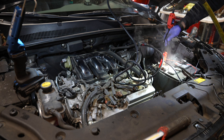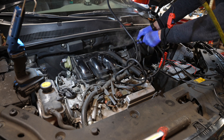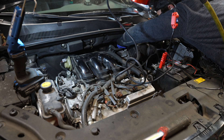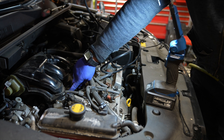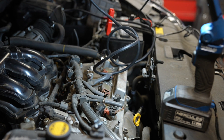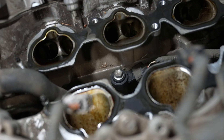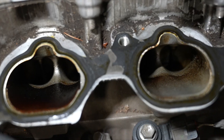The bladder system actually has an entry port so you can hook your smoke machine up right into there. The most important step is do not let this smoke come outside of the car because it's absolutely stinky and it only gets worse as the smoke dissipates. The general leak is either lower intake manifold, valve cover, intake manifold, or injector o-ring. The smoke machine gets a little tricky here — you have to pinpoint where the smoke is coming out because it's just belching out everywhere. I've pinpointed it to roughly the intake manifold, but it could also be a cracked intake manifold or just a bad gasket. The vacuum leak was coming from underneath the lower intake manifold and we can see the gasket is broken right there.